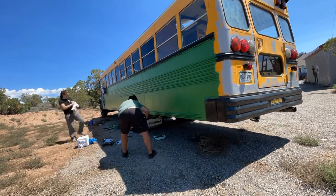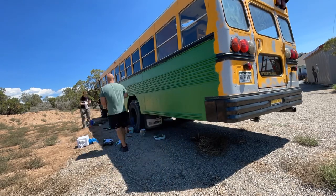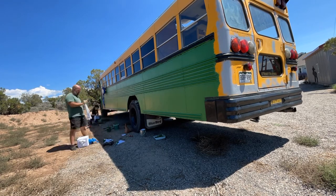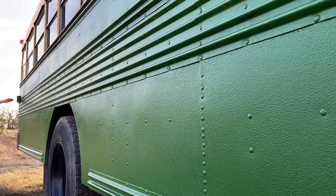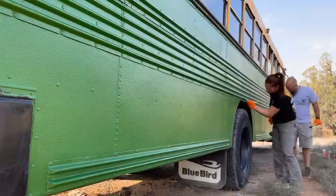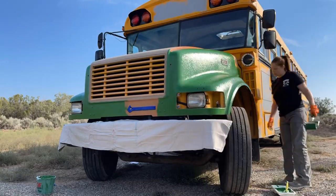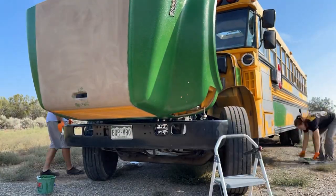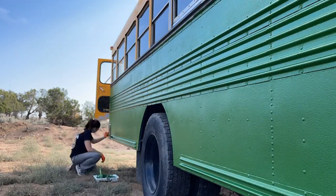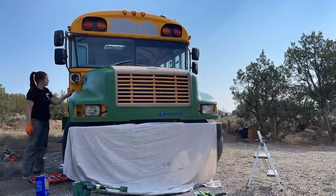I've done four other vehicles this way and I'm very good with it. After the second coat is on, it's nice and thick. When this stuff is dry, it is basically bulletproof. It is safe to drive after 24 hours, but you should give it at least a full week to cure for it to be 100% hard — and if you're going to use it in a storage bay or truck bed, two weeks would be most ideal. The texture is really nice. We did a back roll to get this texture, giving it a tighter look that almost resembles what you'd get with a sprayer.